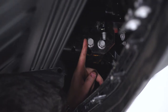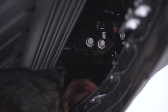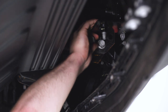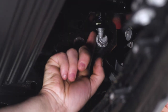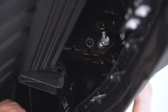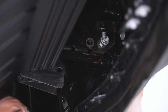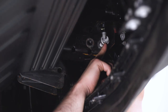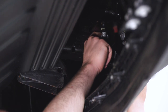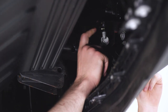Here we are behind the bumper on the driver's side tow hook. It's a little bit tough to get at with this bumper mount, so I'm just going to take the 18-millimeter short socket on a ratchet and a wrench on the nut and loosen that up. The one in the rear I'll hit next — you should be able to get to it with the impact gun if you have a U-joint. That one threads right into the tow hook itself. We're actually still running into that other bolt — this is a design flaw that's existed on older Silverados as well. Fortunately on the new trucks you probably don't have to remove the whole bumper, just this bolt. I'm going to get this bolt out of the way to give a little bit more clearance past that welded-on nut.